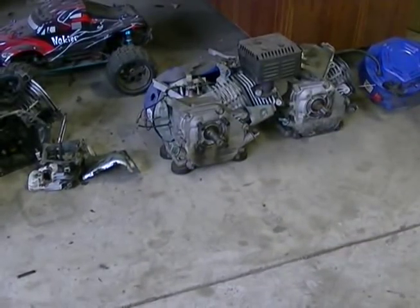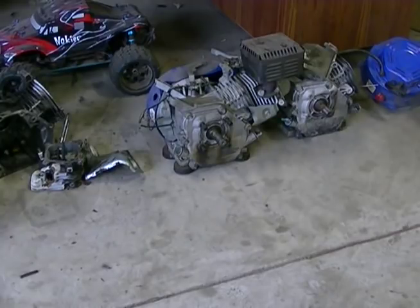What we're going to do is get one of these motors put together, run it up, make sure it runs okay, then change it out for our little side valve motor. Without adjusting anything on our new motor, we'll run the test under the same load and actually see what the fuel consumption is. So we want to see if a bigger motor working less uses as much fuel as a small motor working more — as far as motor size to cubic capacity goes.